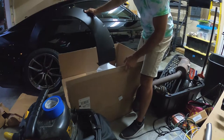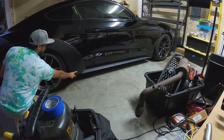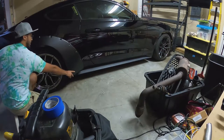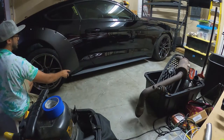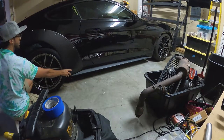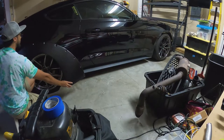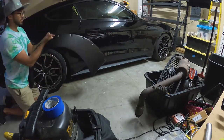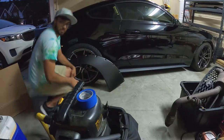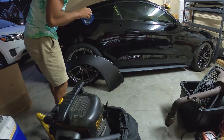So my thought was it would go like this and kind of flex it. Since it's plastic, I might have to flex it a little bit. The problem with flexing it is the more you squeeze it in, the further out the flare sticks. And the more you flex it outwards, the flatter the flare gets and the less it actually sticks out. These flares are a 2.7 inch bump out. Let me take it on and see if we can get it where I think it should go.